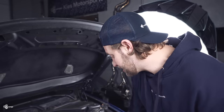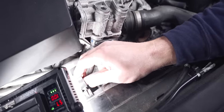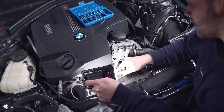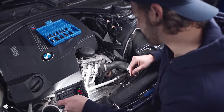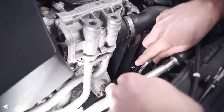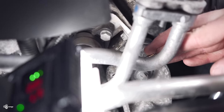So this is gonna be really hard to see, but at this time, let's do this. Now, one thing that you might wanna do is release your coolant line here just so we can wiggle it out of the way ever so slightly. I'm gonna take my massive T60 here, and if you can see it, the hole is up here. We have to line it up with up here. So I'll point to it with the drill bit. The hole we need to stick this in is right over here, and then it has to catch on this little groove right there.